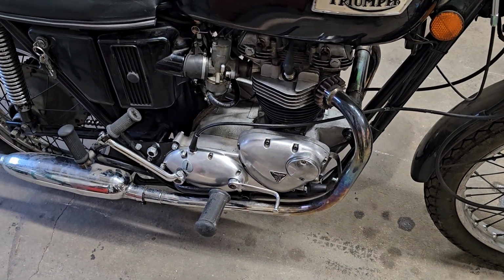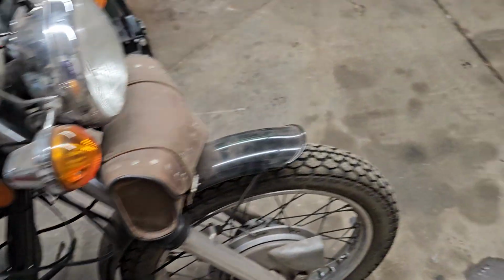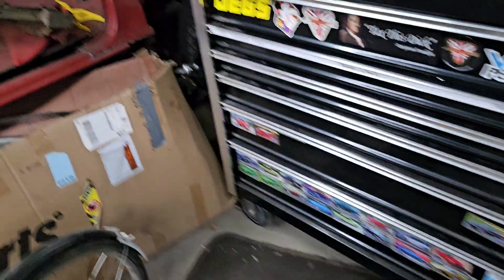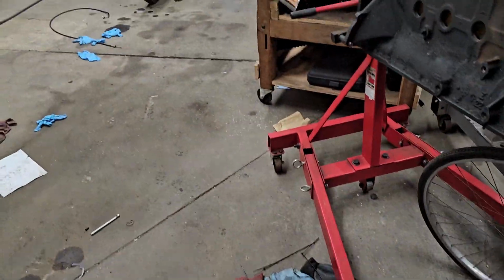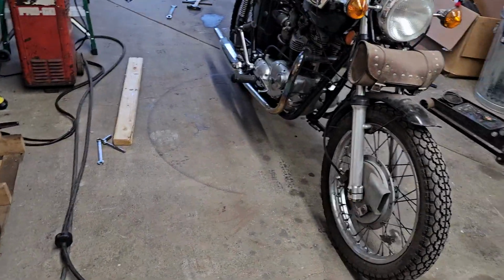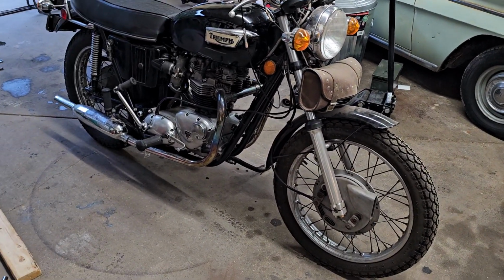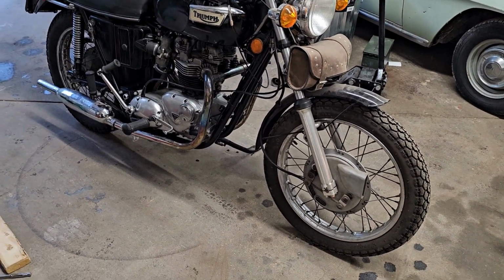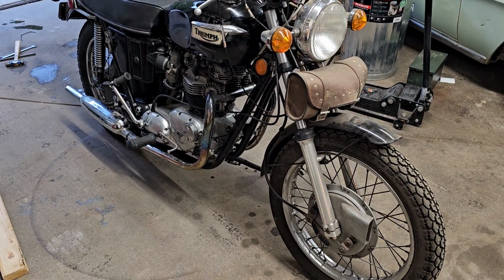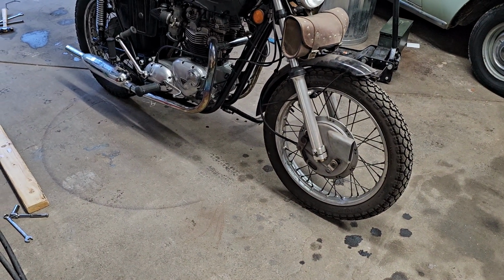Yeah, it starts all right, and it does idle. Does idle quite well. It killed out because it was cold. And these are more aggressive cams. This is only a moderate compression engine. It still needs some tuning. I'm just gonna need a carburetor rejet now, over the winter, because we changed camshafts, we went to the half race cams. But even to idle at 1,000 RPMs with those lopier cams, I'm very happy with that.